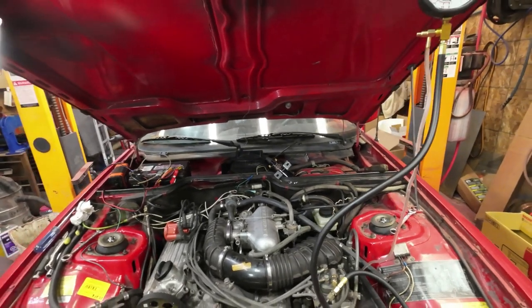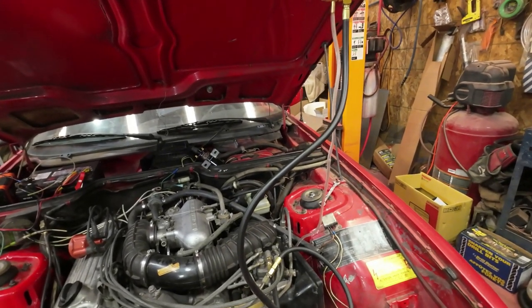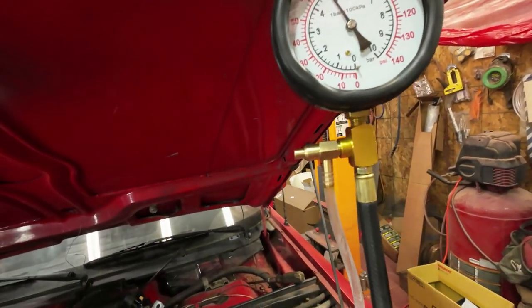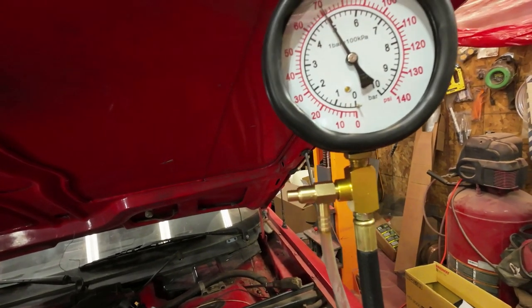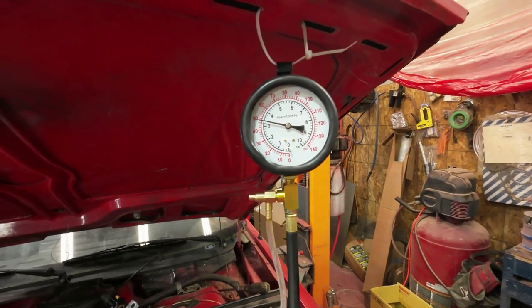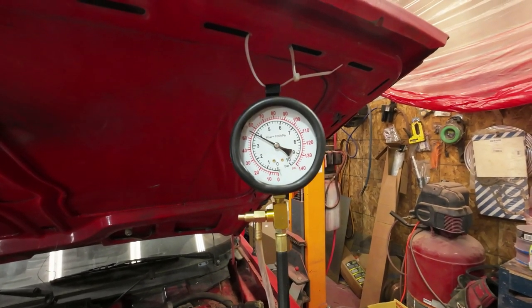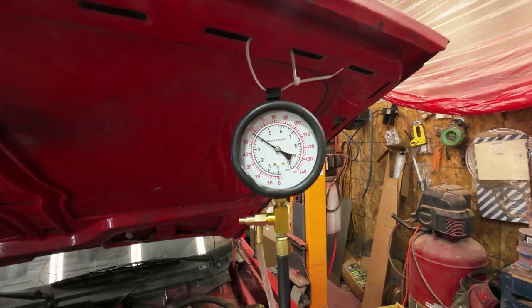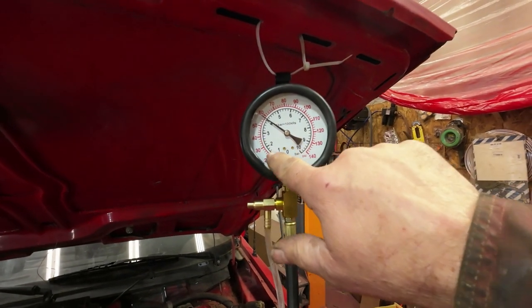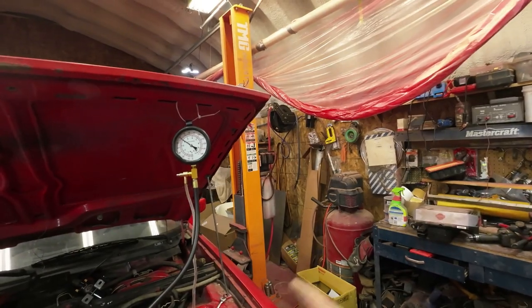Now I'm going to do the pressure test business and open this up to see what the cold pressure is. Yeah, so there's the operating pressure, or whatever you want to call that, and then cold pressure goes down to 3, and then you let it rise till it's happy again, and it's getting up around 4, right? I think it sits around 4, so it should be at 1.5, should be way down here when it's cold. So that means too much fuel is coming through, right? I think so. Hang on.